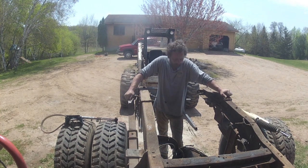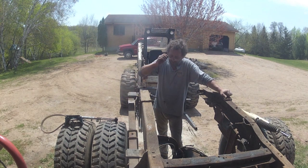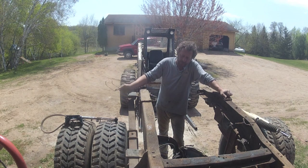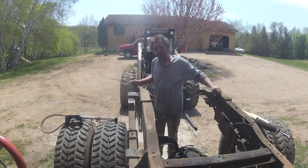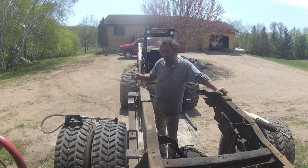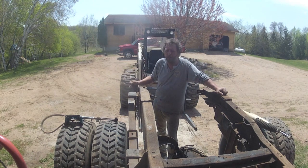To switch this all over would be to unbolt the U-bolts and take the lift kit springs off at the spring eye bolts and put them underneath the other truck. But we have a little bit of a problem with that. The spring eye bushings on the other truck are all dry rotted out, so they need replacement.